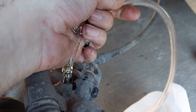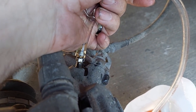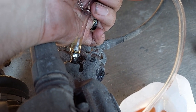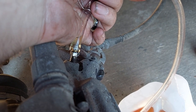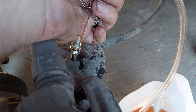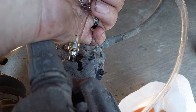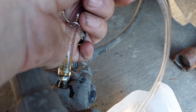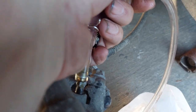I'm trying to avoid making an enormous mess on my driveway or patio. I'll probably get an assistant to help me — we're going to do the pump method instead of gravity bleed, try to force this through the system. The point is you want to keep moving fluid through here until you see almost clear DOT 3 coming out.